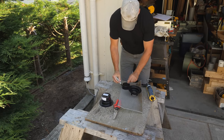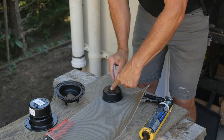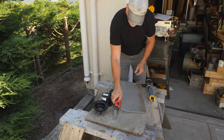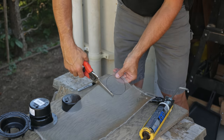I covered all the tank plumbing in part two of this series but I forgot to add a vent. For this I bought an RV tank vent and added a bug screen — I cut a disc of aluminum window screen and siliconed it to the base of the vent. I'll have links to these parts in the description or in my blog post on my website.